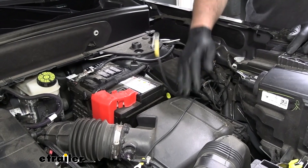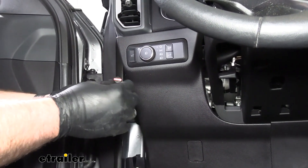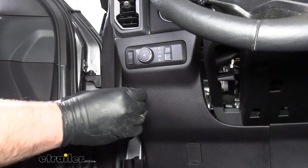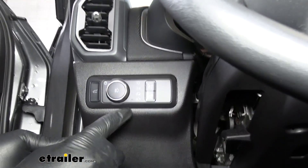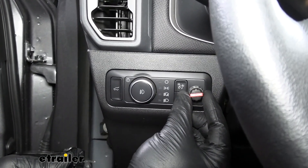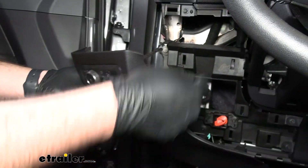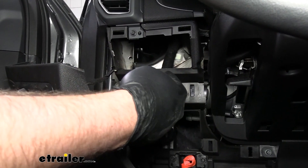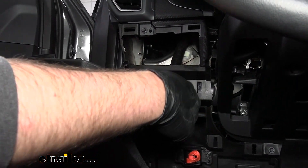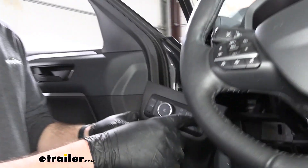We'll wait to make the battery connections until everything else is wired up. Finding the right place for the switch is the most important part because there are many places these switches won't fit. We found a good spot on the switch panel to the right. You want to check two things: whether the knob itself will fit, and whether there's enough space behind the panel. We pulled the panel off and confirmed we have more than enough room. Some people prefer mounting near the cup holders since their hands are already there in an emergency, but we'll mount ours on the switch panel.